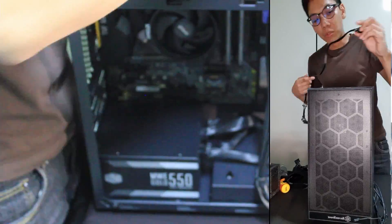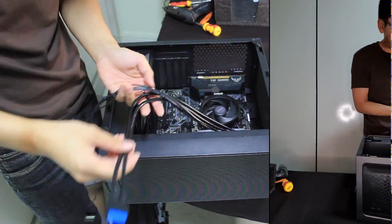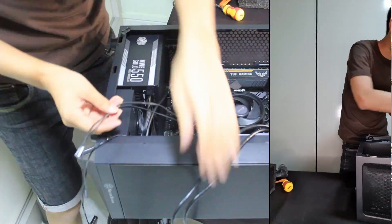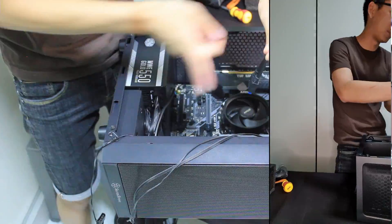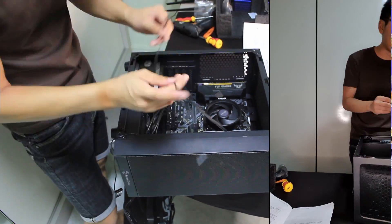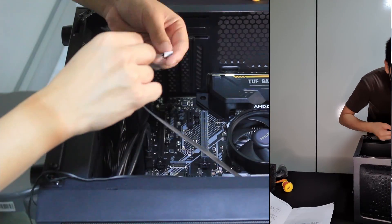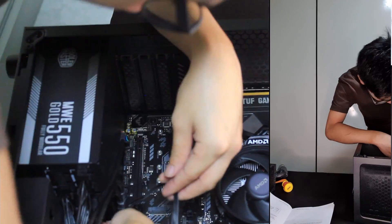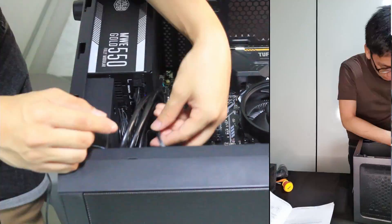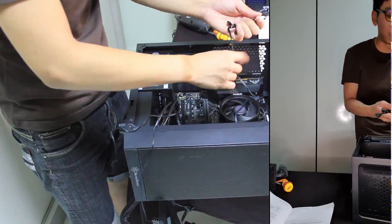After that is done, install the others — for example, the graphics card 8-pin, connect the molex and also the SATA power. After that, do some cable management and figure out what is what. You have your USB 3 and the front panel audio — connect those in; it's usually in the lower left side. Now this is the USB header — put it in the USB 3 header, it usually goes in one way. All these headers usually go in one way, with the exception of the front panel header. The front panel connectors are very important because some of them are positive/negative sensitive. So you've got to make sure that they are in correctly, which is actually quite annoying — I'd advise referring to the motherboard manual for the diagram of which goes where, since the labels on the motherboard itself are not always very clearly readable due to the small space.